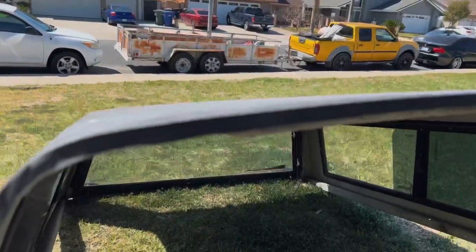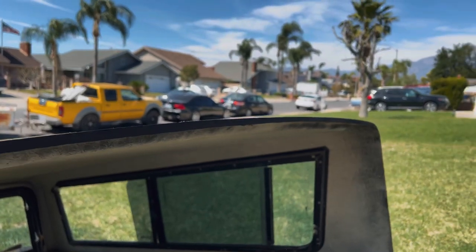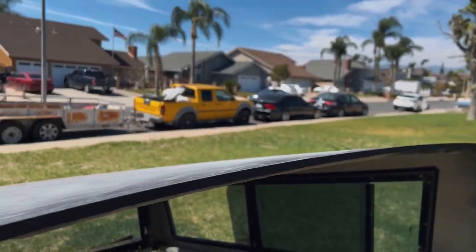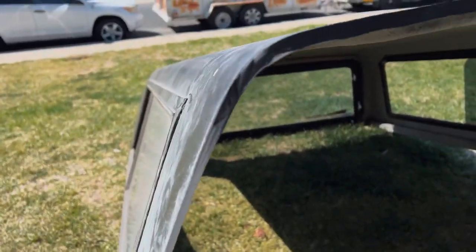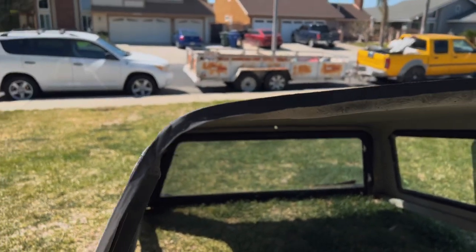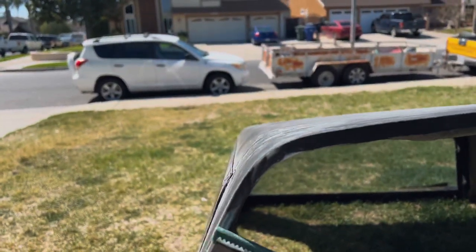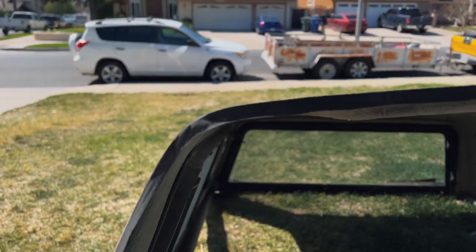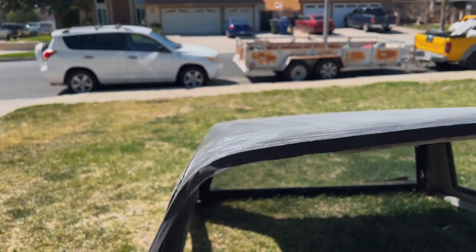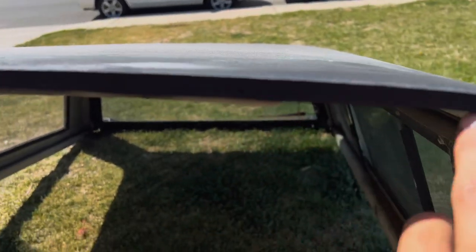What I did is I just got some black spray paint and I painted the edge right here — just a very thin coat, pretty light — and I sprayed it black just so we could see the low spots. Over here is a good example: on this side we just did a quick little shave up and down. You can see if it's white that means it's good and it's flat, and if it's dark like right here you can see that that is a low spot. So up here where it's white is where I hit it a little bit, and then obviously it missed this little portion, so this is a low spot — which is a good indicator that we need to keep working on it right there.